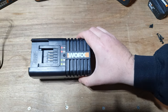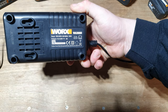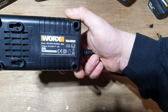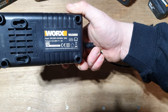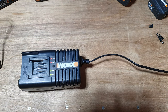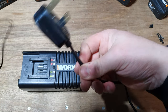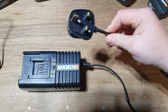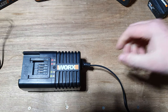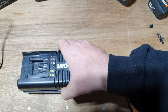Next up you've got this — it's a very familiar charger I'm sure most of you know. It's the WORX WA3860. It's also capable of doing 14.4 volts, which is the lesser-used cells, and it puts out 2 amps. Input is 100 to 240 volts and it's 50 watt power. On the other end we have got a UK plug — a standard 3-pin plug. In America they just snip that off and put a US plug on it with the 2-pin non-earth setup, and the same with European, because it's 100 to 240 volts.